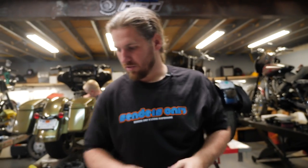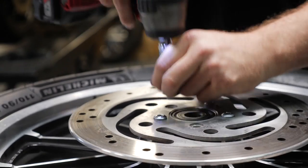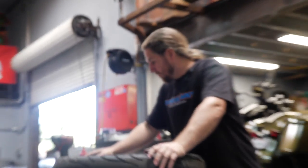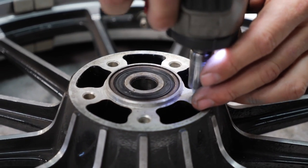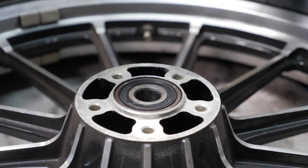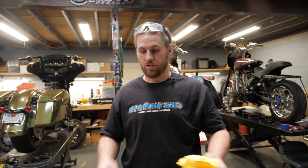We're going to start with a T40, go around and get all these broken loose so we can get this rubber off. Now that we got these removed, we're going to go ahead and blow them out with some air, take a thread chaser, and get these threads cleaned up. Normally this is a very important procedure to do, especially on a bike this old — a lot of these threads are normally gummed up with Loctite. Now that we got everything off and all the threads cleaned out, everything looks good and is ready for install.